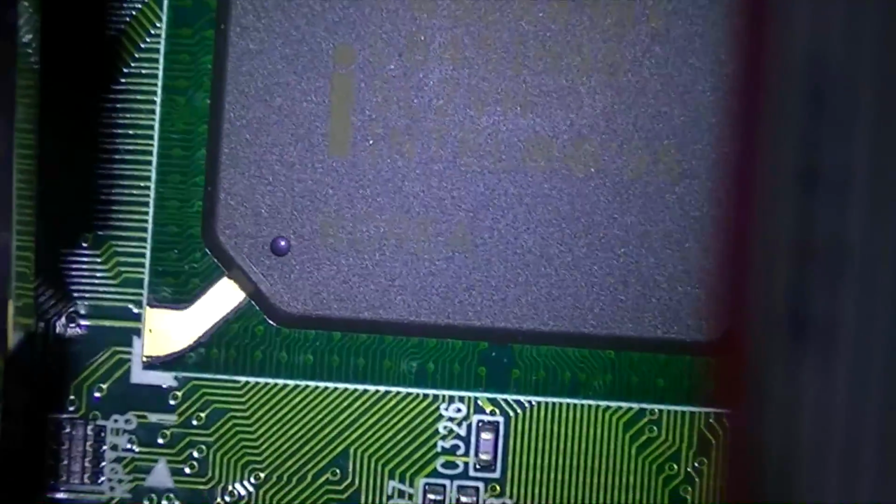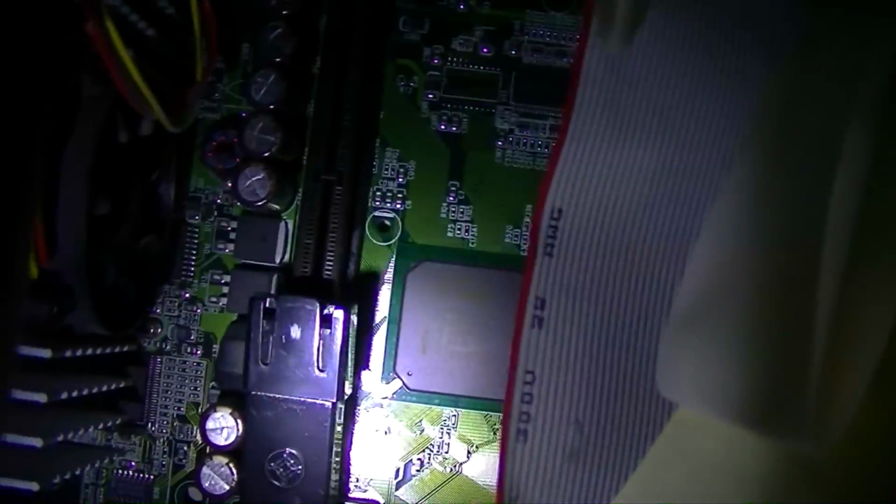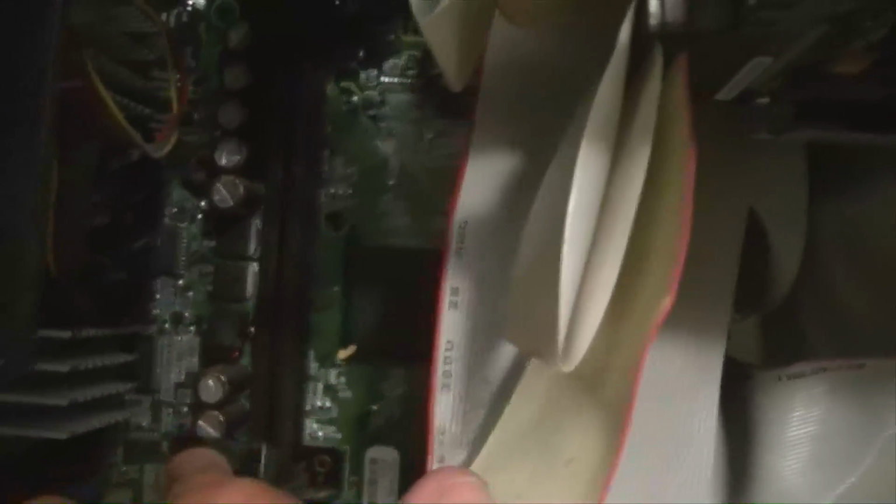That's actually surprising that SuperMicro used the BX chipset for a dual motherboard as opposed to the GX board, but then again, a lot of manufacturers were using the cheaper BX chipset for their dual processor configuration motherboards. ASUS and ABIT were a couple big ones that were doing that back then. So I wish I could find my second processor, but I don't have it right now.